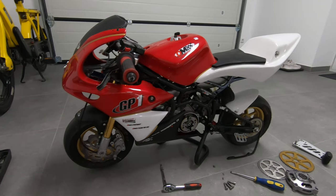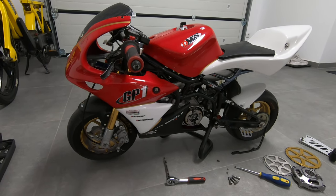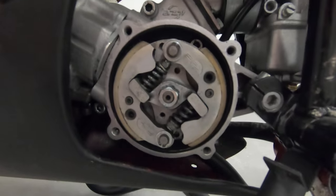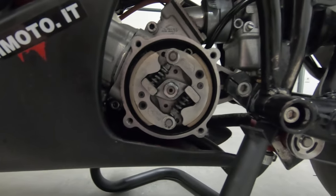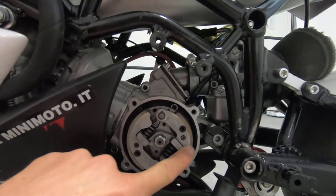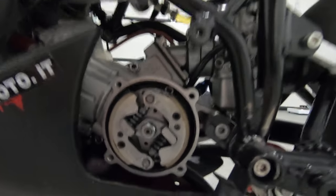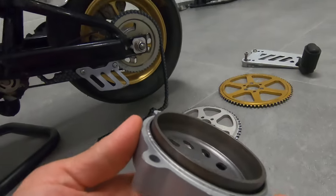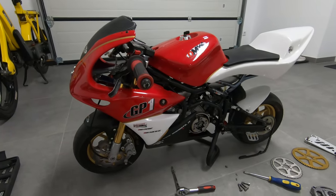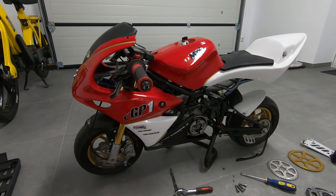I can't find it so I'll need to buy a new one. The first thing that suffered from the power was the clutch. I bought this one — it's a PF clutch — I don't remember exactly, but it's very long so you have a very long grippy surface that fits in the clutch bell. On the dyno it output 20.3 horsepower on normal fuel.